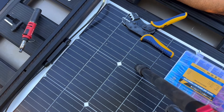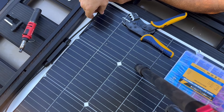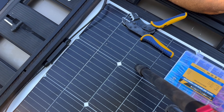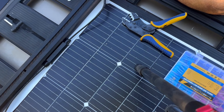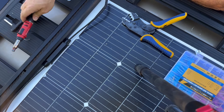You almost have to wait just a second to let that cool, because if you try to move your heat shrink while it's hot it'll shrink right there. I'm going to bring that one on first, going about three quarters of the way, because then I've got this other one that'll go over that — so you get a nice tight seating on it. I feel good about that being watertight. Then this one I can come the opposite direction, go over the top of that, and shrink that down. Really triple protection: two heat shrinks plus the crimp itself has its own heat shrink.